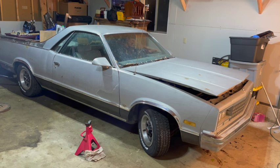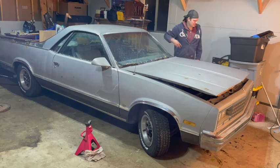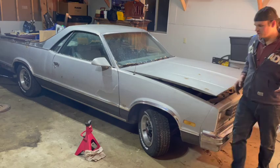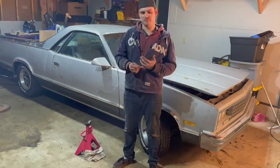As you can see, it is missing a little bit. There's a very high possibility that the spark plugs are fouled out from it running super rich the past few months. So what we'll do is tomorrow — because it's getting late — we'll pull the spark plugs out, clean them as best as we can, put them back in, and see if that solves the problem.